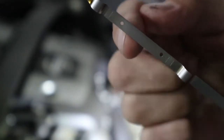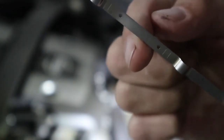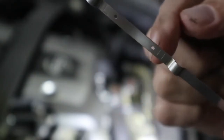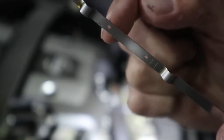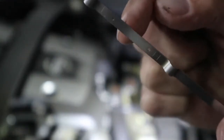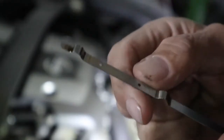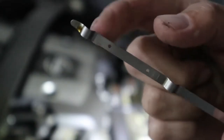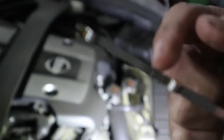What you're looking for on the dipstick itself: you'll see there's an H mark on one side and a low mark on the other side. This indicates high and low oil level — you really want the oil to be in between somewhere. It is always better to check the oil when the car is at operating temperature, and you want the mark to be closer to the hot or high side than the low side. The oil needs to be in between — it doesn't have to be on the high mark, but it should certainly not be on the low or minimum mark.